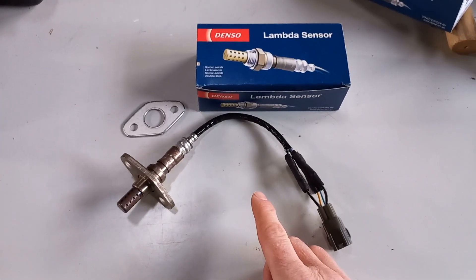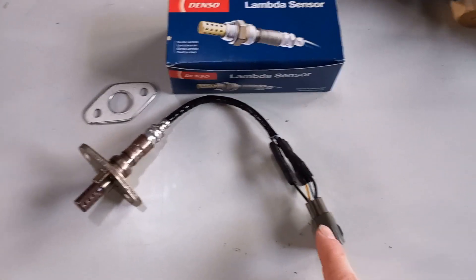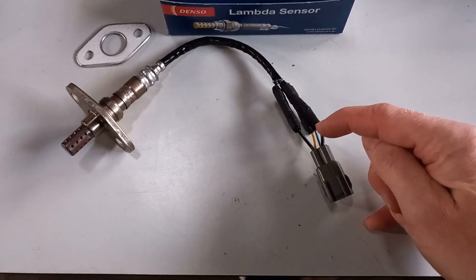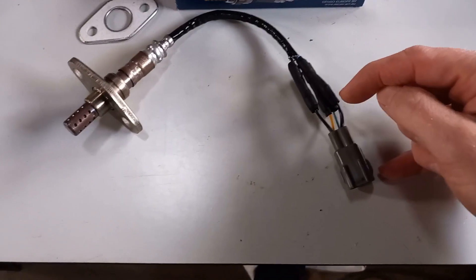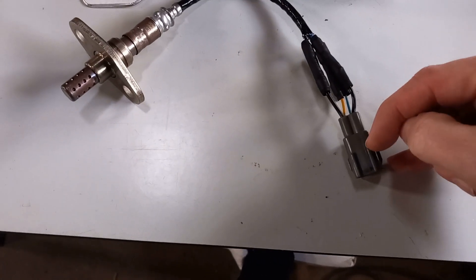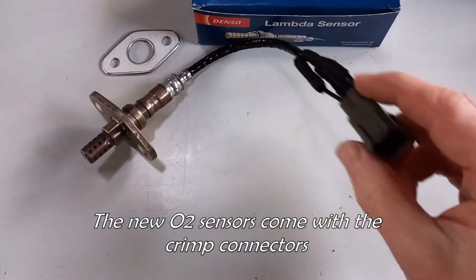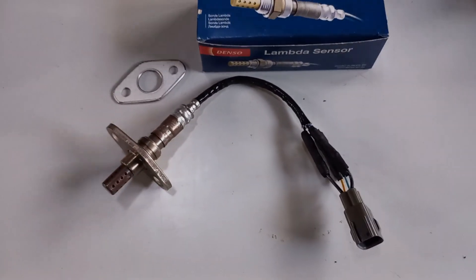This is the end result just before I put it in the car: the new O2 sensor with the old connector. Unfortunately I couldn't solder the wires directly to the pins in the old connector, because the solder doesn't adhere to the new wires — it's a very heat-resistant material. So what I ended up doing is using pieces of plain copper wire, soldering them to the pins, reassembling the connectors, and then using crimping connectors with a little bit of heat shrink. So now we have the new O2 sensors with the old connectors, and it's time to put them on the car.